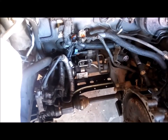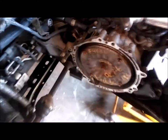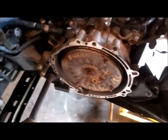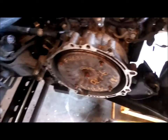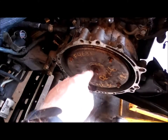It goes down there on a tube. Looks like it goes right to the power steering rack and pinion steering system. And I replaced the front transmission seal, so behind that torque converter. Like I say, this tranny's been replaced, and I bought new torque converter nuts for the flex plate, and we got anti-seize on there, anti-seize around the pilot there.